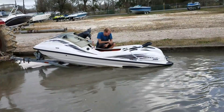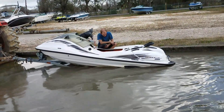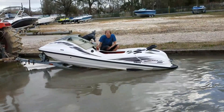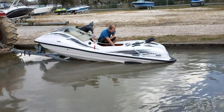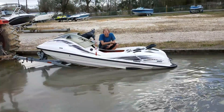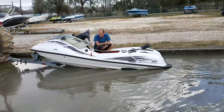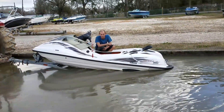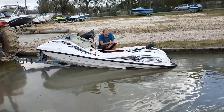Matthew, the technician, pulled the carburetors off and found some internal problems — the carburetors weren't built properly. Luckily the engine did not suffer. He's had to do quite a few things: drain the fuel system, all new fuel lines, rebuild the carburetors, replace the reverse cable, new spark plugs, and also had to have a new stator.